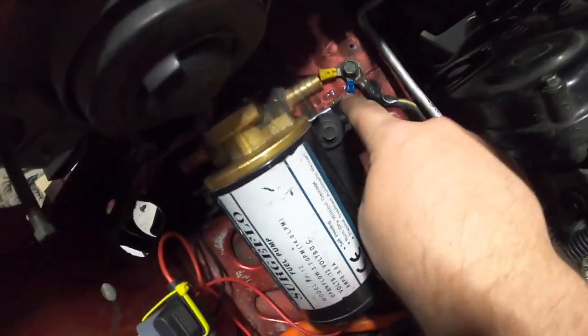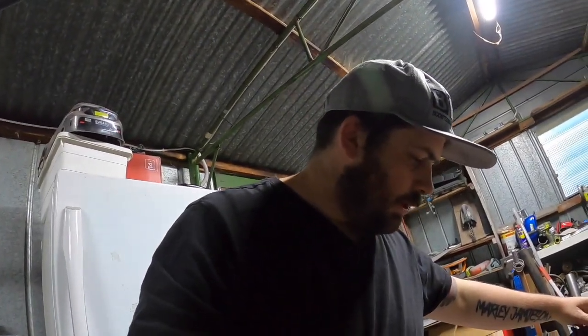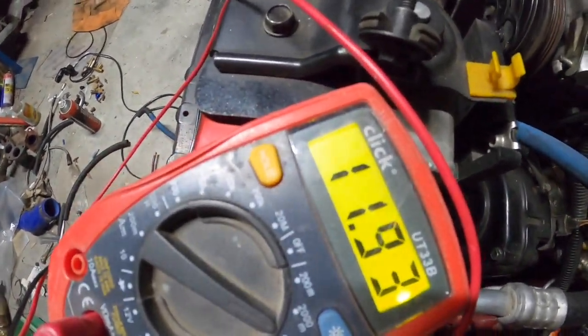By the look of it there was a little bit of oil in there because it's spewed down just a little bit here. We'll check the power of the battery - 11.94 volts. It's a pretty crappy battery anyway so that's expected. Let's check it here - I'm pretty happy with that, only one volt drop in power, very happy with that. Oh, that's my fuel - that's not good, hopefully a fuel line hasn't gone dodgy.